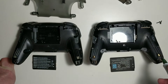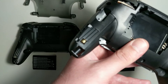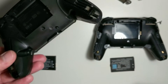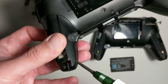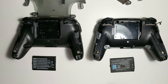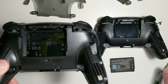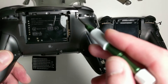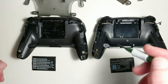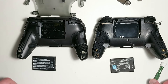Looking at the handles, there are two little holes where you can see the rumble motors. On the fake they're gold and rounded — cheap impulse rumble motors. On the official Pro controller you can see a gray block, which is the casing for the HD rumble. So if you're buying a fake, you won't get HD rumble. At the top where the triggers are, the board on the original is a dark color and not noticeable, whereas on the fake it's a much lighter color and clearly visible.